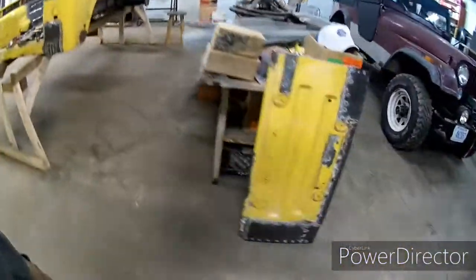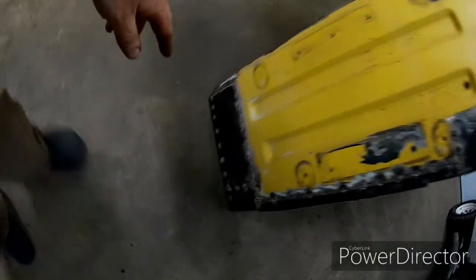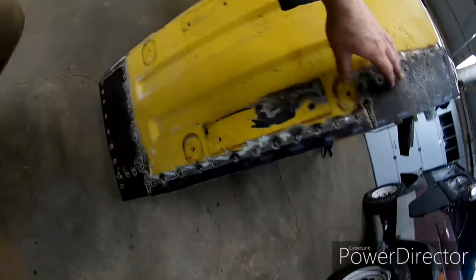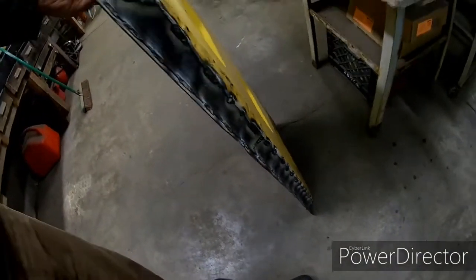The other thing we've done is worked on this rotten old tailgate - stitched a bunch of patches in. We cut the handle portion out, cut out some rusty spots at the bottom, cut the handle portion out of this side, and just tacked in a patch. The bottom of the tailgate was all rotted away, so we just rebuilt it.